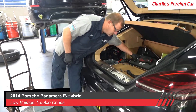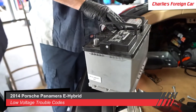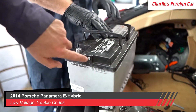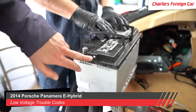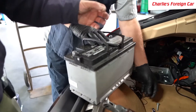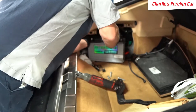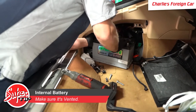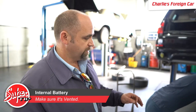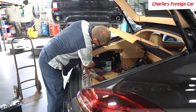Very important on these newer cars. The vent on this car is toward the back of the car, so the Interstate battery comes with a vent that could be vented on either side. We've plugged one side — the other side is open to our vent hose. Anytime there's an internal cabin battery in a car, you always want to make sure that the battery is vented properly. So we're hooking up the vent, making sure that it is venting to the atmosphere outside of the car.